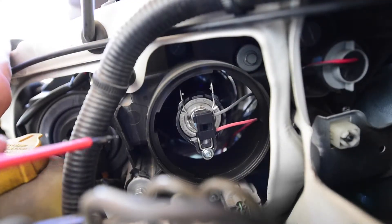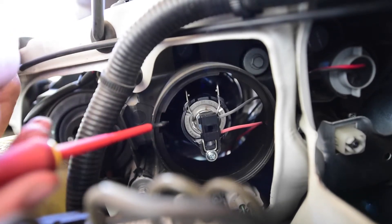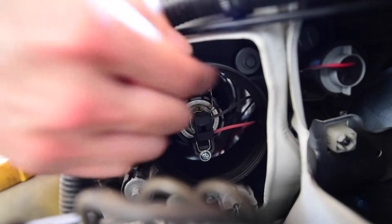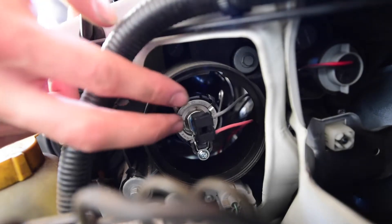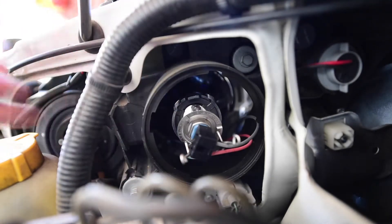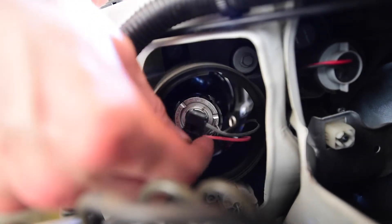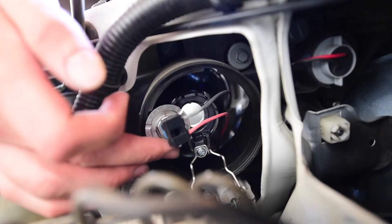So here we are on the driver's side of the vehicle. We've taken off the dust cap already, and here we have the H7 OEM globe. To get this globe off, we simply pop off these metal tabs — when the two tabs are off they'll drop backwards, and then the globe itself will pop out separately. For most cars it'll be slightly different depending on the globe type and configuration, so you can always check your OEM handbook on how to change the globes.